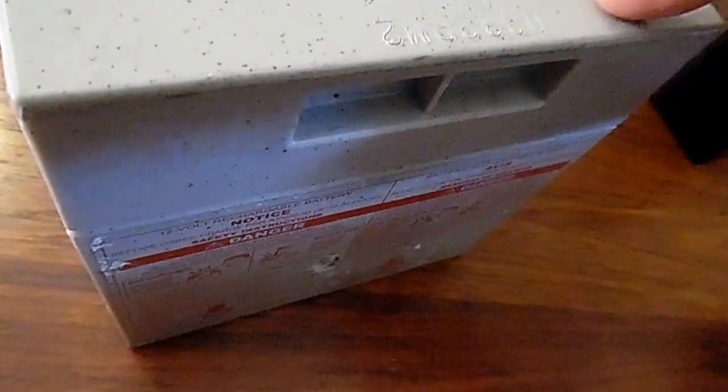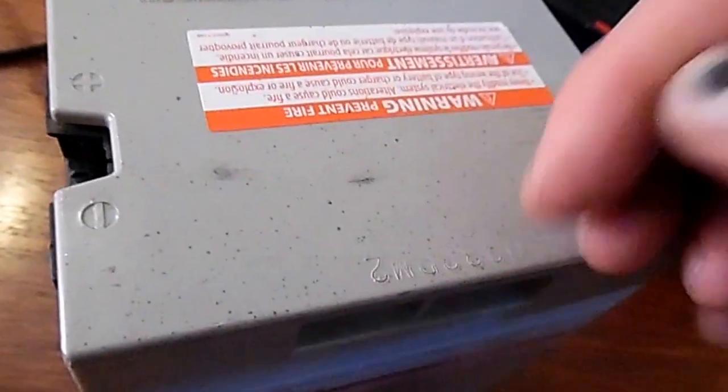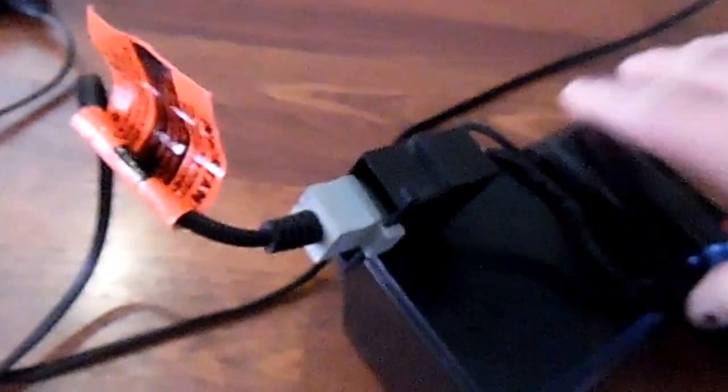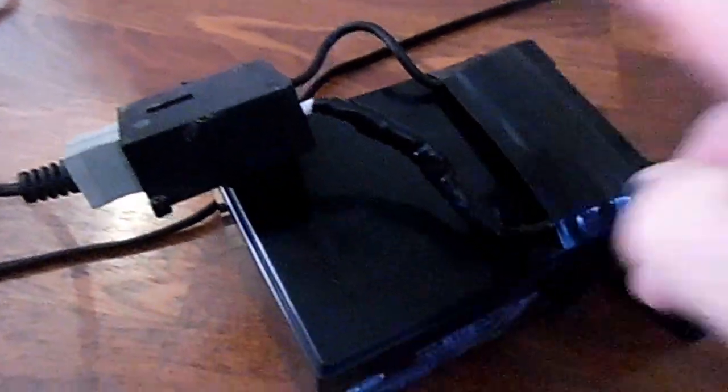The black wire is over here, and there's a circuit breaker right here. Just pry the top off, cut the wires off, and you'll make yourself a little plug so you can use the same charger and hook it up to your Power Wheels easier. There it is right there — the white wire goes to the positive and the black to the negative.